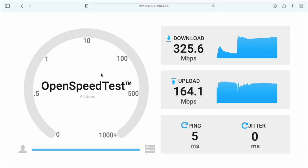As you can see from those results, having the Wi-Fi router on a different floor can slow things down, although those are very respectable speeds and would work for many things. To clarify, I'm testing the speed from the computer to the router, not to the internet. So if you have 100 megabit internet service, having 500 megabits per second on your Wi-Fi is five times faster than your internet. If you have gigabit service, your Wi-Fi could potentially be slower than your internet. For reference, the highest 4K movies take about 24 megabits per second, and a regular HD movie might be about 5 megabits per second.